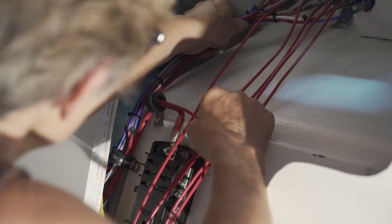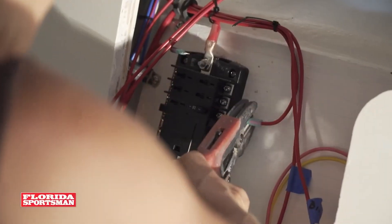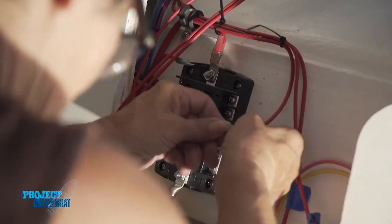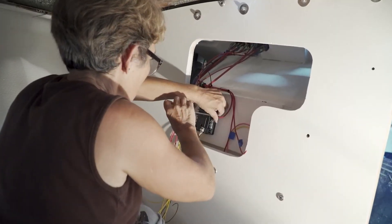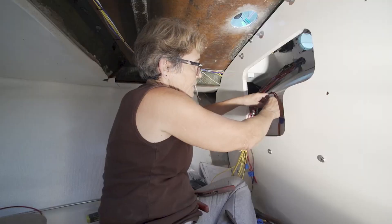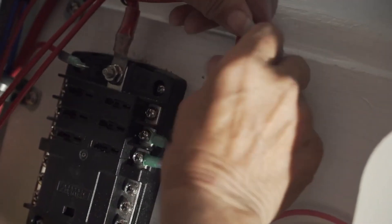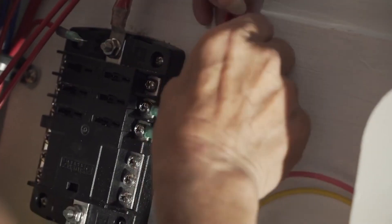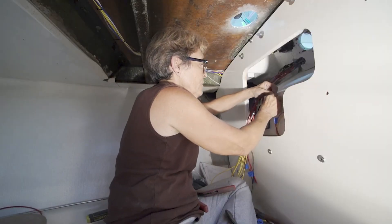Once I'm done cleaning everything up, I'll start my power wires. My first one is always my nav light — I'll run it where it's going, put my ring terminal on it, tighten it up. Then my next ones would be my two bilge pumps. I'm also doing it this way because the boat has to go to Coastal Marine and I'm allowing room for all his harnesses to come in for twin motors.